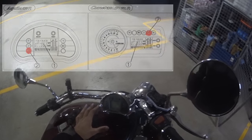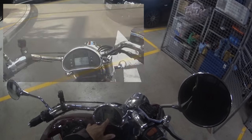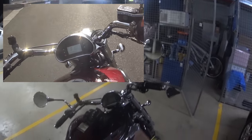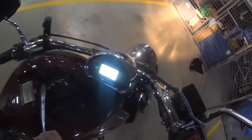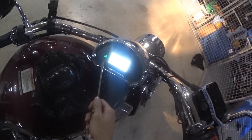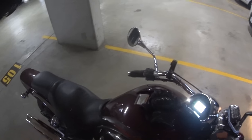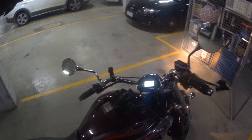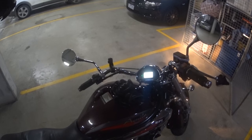You'll notice that a fault indicator light, or FI light, will come up and it will flash FI on the screen in big letters when you're riding around, and it can be quite annoying because you can't tell what speed you're going. FI will be displayed where your kilometres are and the red FI light will come on. When I'm riding around the fault comes up when I'm approaching a stoplight, so I want to read that fault to work out what code it is in the manual to try and rectify the problem.